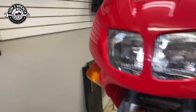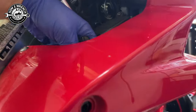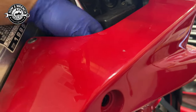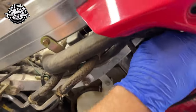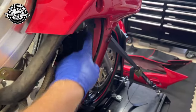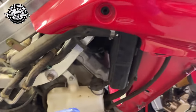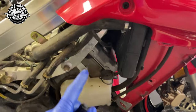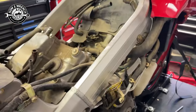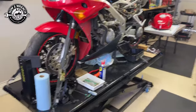I have more detailed videos on what to do when you're trying to bring a bike back to life or working with an unknown bike. We also want to address the cooling system — it gives us clues about what's going on. When I pulled this bodywork off, I could see the reservoir was empty. I've got the cap off but I want to grab my borescope so I don't have to take this fairing off. It's wet, so there must be some fluid in there, but I want to get in and find out — use a zip tie or something to check how low it might be. And then the question is: where did it go? If it's not on the ground and I find no external leaks, I want to address that, especially while it's apart.